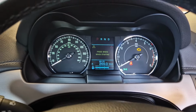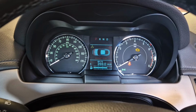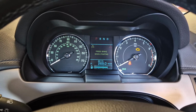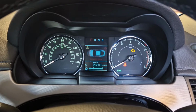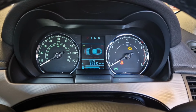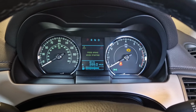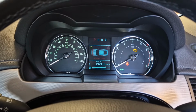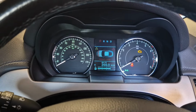Basically, Jaguar decided on this model that they would do away with an oil pressure warning light, and instead, when the oil pressure gets low on this car, you will get a message coming up saying low oil pressure. So when you go to do a startup after doing an oil filter change, there's nothing to see really on here. There's no oil light to watch to go out like you've seen me doing on other oil changes. You've just got to basically start the engine up and make sure you get no message saying low oil pressure. If you don't get any message, everything is fine. And on the 4.2 XK, the oil is checked on a dipstick in a conventional way. So let's go for a start up.